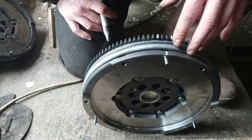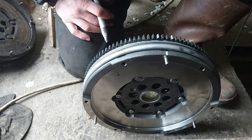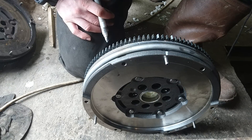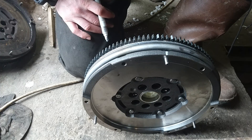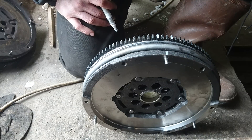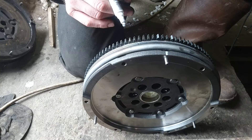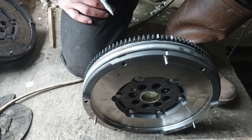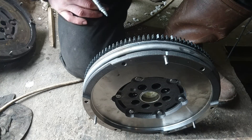All the information can be found online — there aren't many videos on YouTube about how to check a dual mass flywheel, so Google it, find your part numbers, and find your specific measurements. For example, for a Volvo dual mass flywheel, the free play is 16 or 17 degrees angle. Feel free to comment and like — thanks for watching.